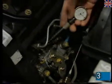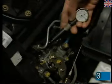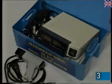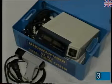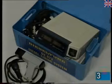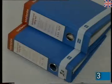To check the injection timing, which should always be done after replacing the cam belt, you can use a dial gauge as in previous models, or alternatively, when the timing figure is available, the latest electronic equipment. This equipment can be used on any diesel engine where the dynamic timing figure is known. The dynamic timing setting can usually be found in the emission and idling data book.